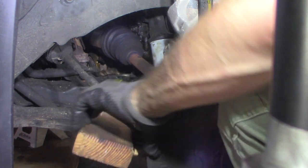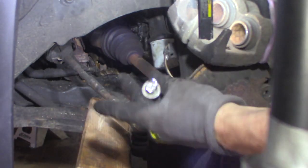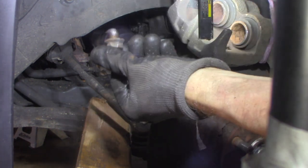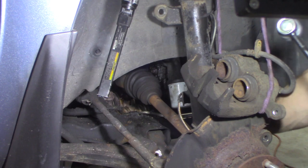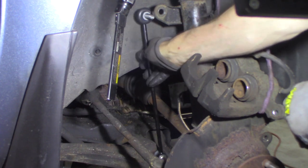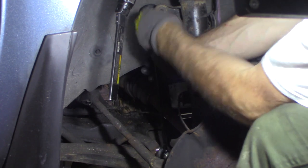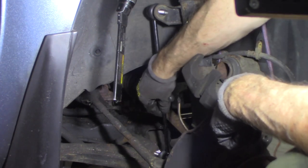There might be no damage to the sway bar arm. It's going to be really hot. You can see I cut it flush as close as I could — got it out. You're right on the edge. I can just barely get the top up here and you can kind of see it's shiny right here — that's the hole for the bottom. So I'm going to start that one first, get it through, try to get the top through, try to get both through. Just push the bottom one out.